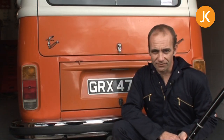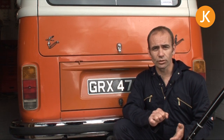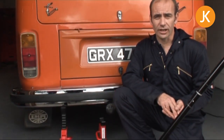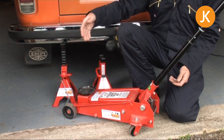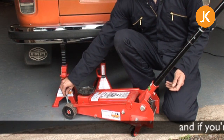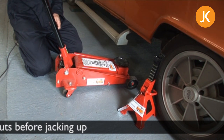We're going to look at jacking up the rear of the van. Before we even start, make sure you've got good flat ground that is nice and supporting, and that you have the appropriate safety equipment. We're going to be using a trolley jack and a pair of axle stands, and it's important that they're rated to at least two tons — these axle stands are in fact three-ton rated. It's always advisable to make sure they've got a good solid locking system. Before you start, you must make sure the front wheels are safely chocked.